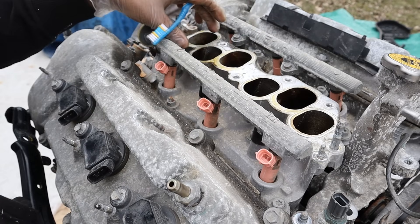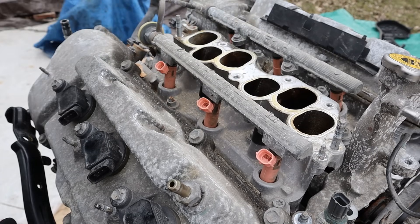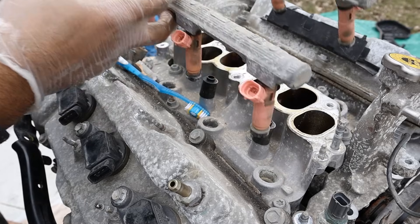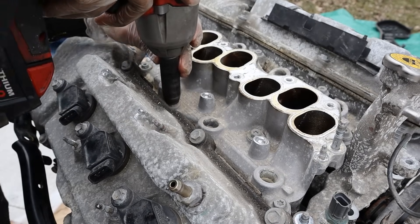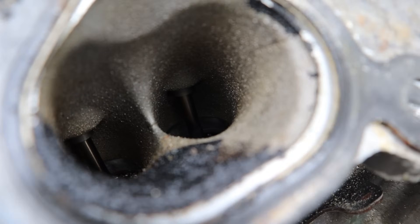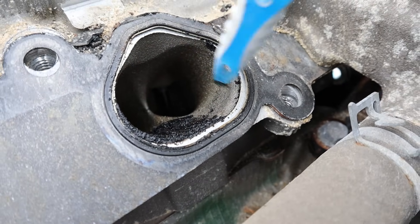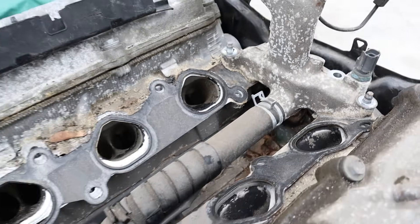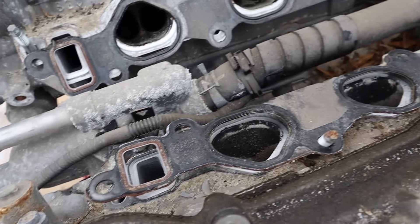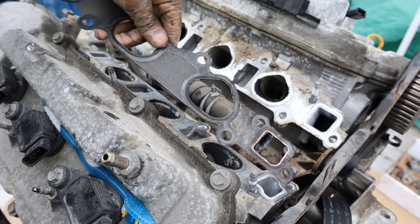Looking down inside, we've got the lower air intake system and the two fuel rails — one on the front bank and one on the rear bank. This only has port injection, meaning the fuel is sprayed into the channel before it goes into the combustion chamber. Looking down inside the air intake, things are actually pretty clean in the ports. You've got sludge and residue coming in from the PCV system, but because the gasoline washes down behind the intake valve, you don't have any issues with carbon buildup. Here is the coolant crossover pipe that goes from the coolant inlet over to the other side where the thermostat lives. Now I can remove that coolant inlet — these gaskets are super thick, they feel almost like exhaust gaskets.